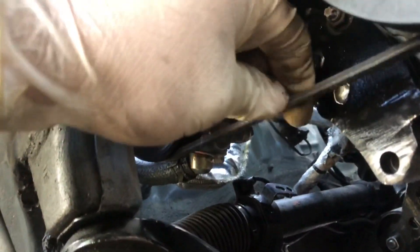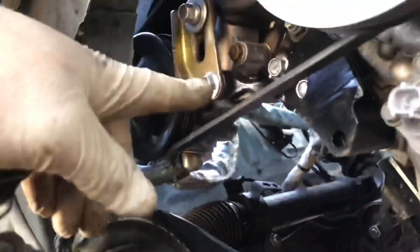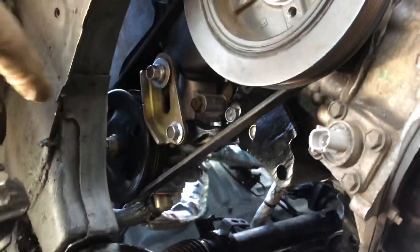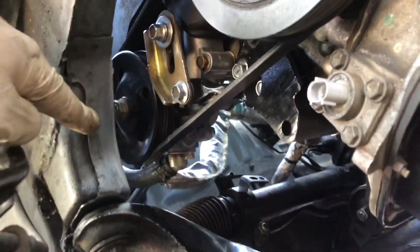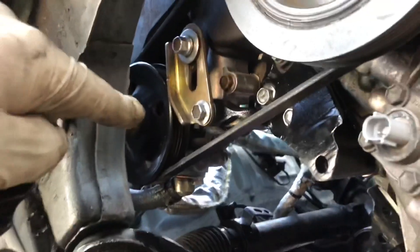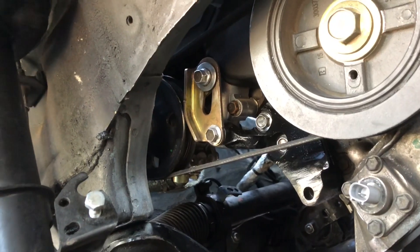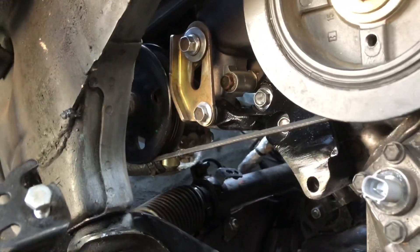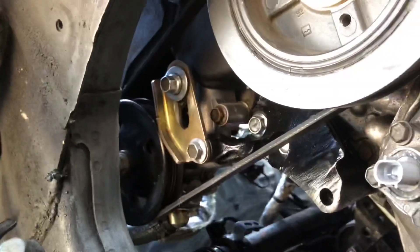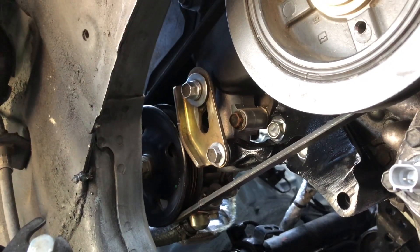I feel like it has a good amount of tension, but it doesn't want to turn all the way — it stops about halfway. So I'm going to have to do a little bit more research on the belt, see if the 1MZ and 3MZ belts are different. But as for the pumps, they're the same. So there you have it — that's how you retrofit a 1MZ power steering pump on a Celica with the 3MZ.